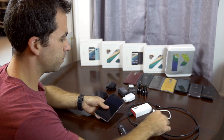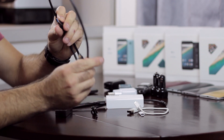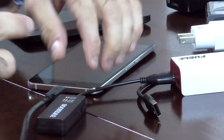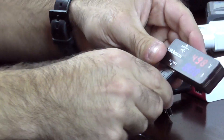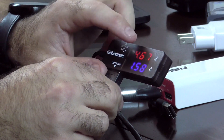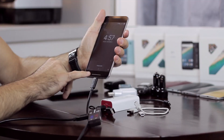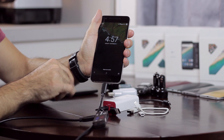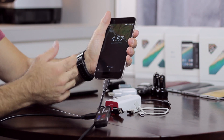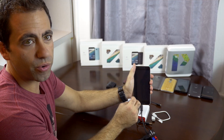Let's try it out on the 6P first. I have a USB-C to USB-A cable, both male. When I plug it in, you'll see the voltage drops a little bit but amperage shoots up. Now we're charging at around 1.5 amps, give or take. You'll notice on this phone it says it's charging rapidly. That's cool because this is not the rapid charger that comes with the device, but it's still showing rapid charging — at least that's what the phone is indicating.